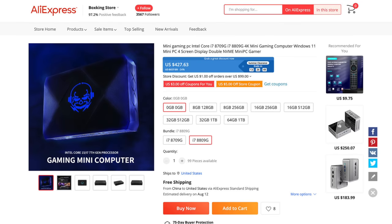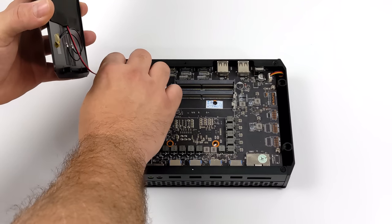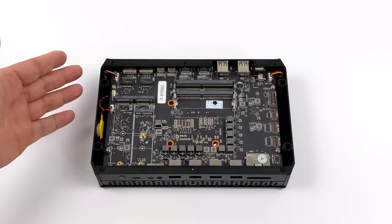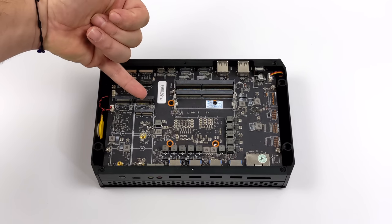When it comes to the F9 mini PC you can pick this up in a couple of different configurations, but I have the higher end model here and I picked up a bare bones unit. I've actually seen these as low as $380 and it's really the same as the Intel Hades Canyon, but this does offer better cooling performance and it's a lot quieter. Since I picked this up bare bones I had to add my own RAM and storage, which is really easy. It uses SODIMM RAM and M.2 SSDs — you can use NVMe. I'm also going to add an Intel AX Bluetooth and Wi-Fi module.